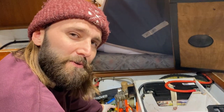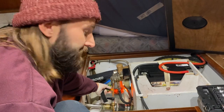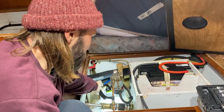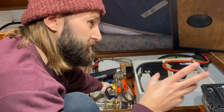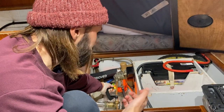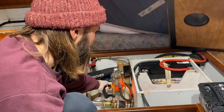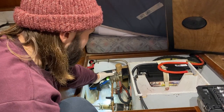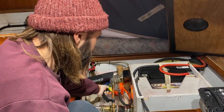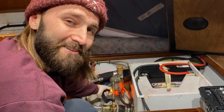This is the primary fuel filter and we need to drain down the diesel that's in there. It's got a little bleed valve at the bottom for any water or condensation that might have come from the tank, sitting in that filter. You can basically just drain that off when you need to, but at the moment we need to drain the whole thing out. Then I think it just unscrews from the top pin and drops out — not done it before so we'll see.